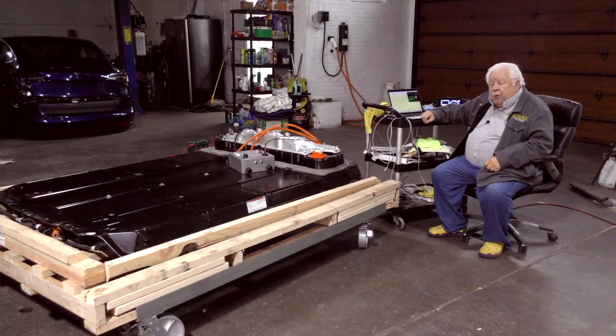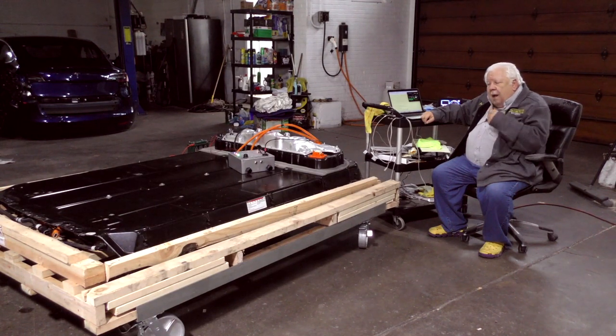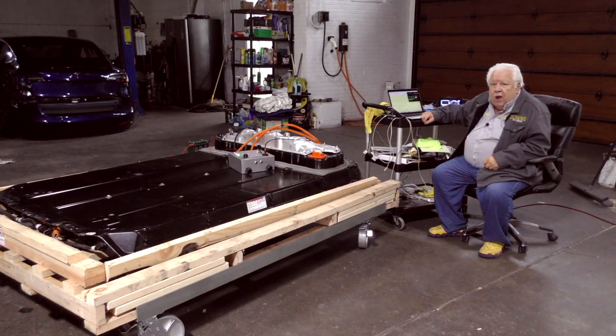What I have here is a newer version of the Model 3 battery pack. The serial number is TG118294-0000-SXS. As described earlier, the original Tesla battery put out CAN message ID 0x401 in hexadecimal, appearing periodically about once every 100 milliseconds. It took quite a few messages to accumulate all the cell voltages for display, since each message carried a couple or three cell voltages.